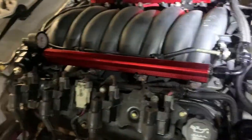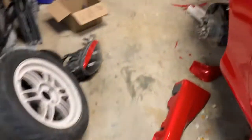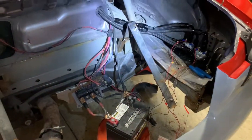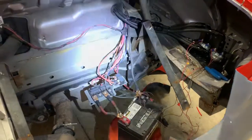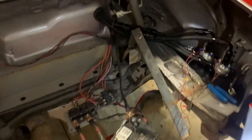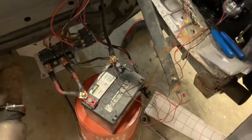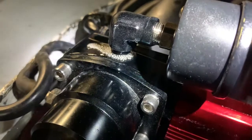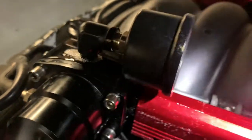You test things before you actually go out and do them, especially when it deals with fuel. For those of you that previously know me, you know that I've dealt with a very bad fire before. Let me go ahead and tighten down this fitting. I'll test it again and if it gives me the green light to start it, then we'll go ahead and do so after we set the fuel pressure. The second issue came about — I was setting fuel pressure and right there you can tell there's another leak. So gotta keep on going.